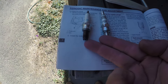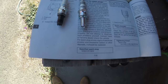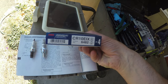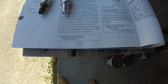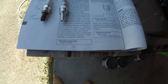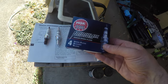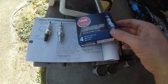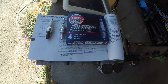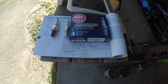The spark plug on the left has two angled metal pieces on the outside part, but the new one on the right just has a little j-hook on the outside. I noticed that the type of spark plugs I got — the CR10EIX — are different from those recommended in the manual. The manual recommends the CR10EK, which is the platinum version, whereas the CR10EIX is the iridium version. I checked at my dealership and saw that for the 2009 Yamaha R6S, both work according to the manufacturer's catalog.